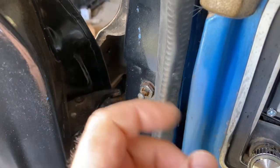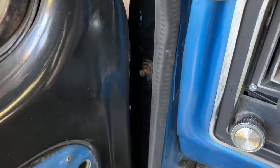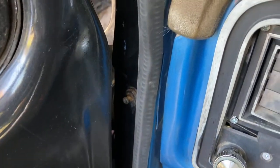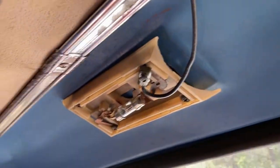So what we're looking at here is the door plunger. When you go to close the door and this part of the door jamb shuts against this, it pushes this in and essentially breaks the circuit and allows the light to come off. When you go to open your door, whether it's the driver or passenger, your dome light also comes on.